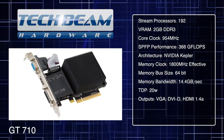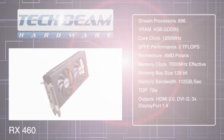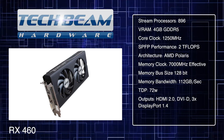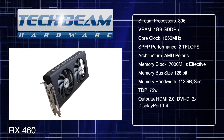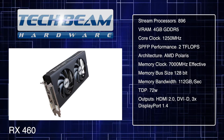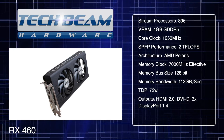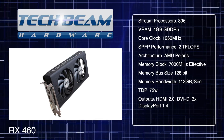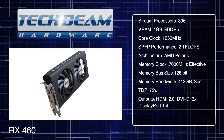The EVGA model pictured is a solid value with 2GB of DDR3 at around $10 cheaper than most 2GB models. If you're looking to do some gaming at 1080p, the RX 460 is without a doubt the king of budget gaming cards. Available with either 2 or 4GB of GDDR5, the 460 can drive 1080p gaming at 60fps with good settings and can be installed in any system with an available PCI Express slot and a single 6-pin power connector. Supporting HDMI 2.0 and DisplayPort 1.4, the 460 is also suitable for running multiple 4K 60Hz displays. The Sapphire model shown is one of the best aftermarket 460s around with 4GB of GDDR5 and a solid cooling solution at just $140.